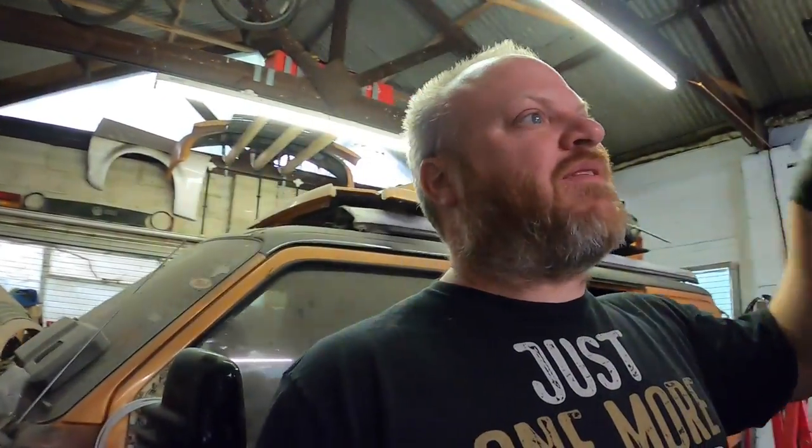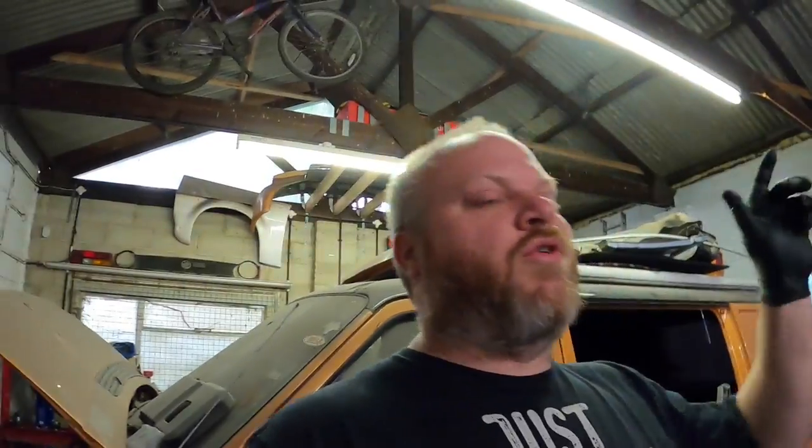In the end, I stopped it from running down there by putting a bit of tissue behind the outlet, because in their wisdom, Vauxhall has put the outlet pointing backwards towards the back of the car. So when you crack the cap off, the water comes out flat out and pees straight down the subframe, and then just comes out of everywhere. Rather than dropping out of one place where you put a bucket, I was trying to move the tray, and I really needed two trays to catch it all. So madness. Next time, note to self, drain the coolant outside, not inside. But anyway, there you go.